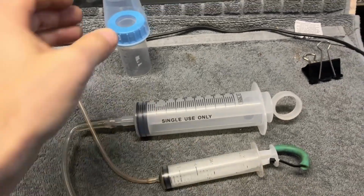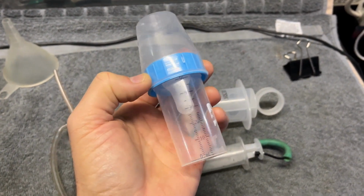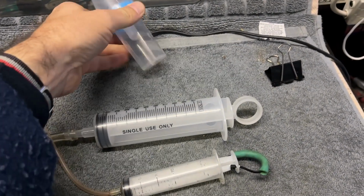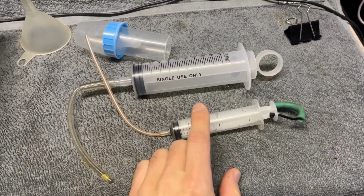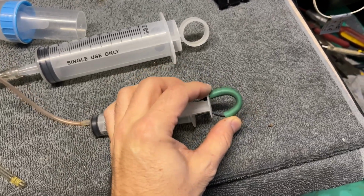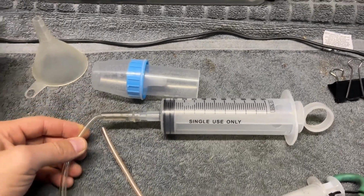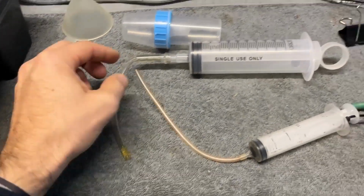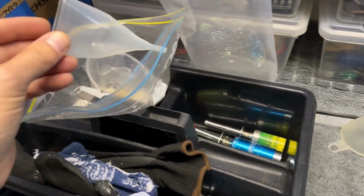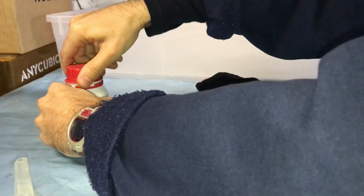Now, the best thing about having children is that the hospital gives you these little milk capsules to feed your baby. Keep them, because they're perfectly graduated for measuring small amounts of oil. Then go through the bin in the hospital and take as many of these syringes as you can. I've made mine more friendly with a zip tie so I can use it with one hand. The commercial size syringes that the nurses use are good for larger quantities. I always keep little tiny funnels, because they make pouring fuel and oil easier. Alright, so we need 12 to 16 mil of oil.